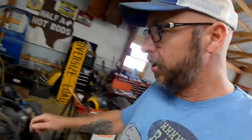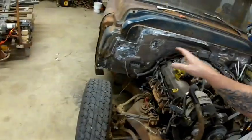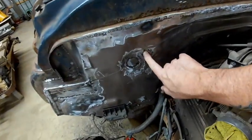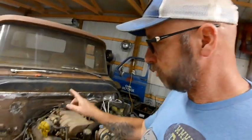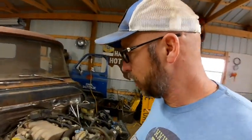So I think what we need to do is just scuff everything, scuff and clean, and then basically we'll paint prep everything here. I really need to address that. I'm going to try and unmess this up. I'll fix it. Yeah, and then we'll do scuff, clean, and then we'll do seam seal and paint, because once the cleaning is done, then we should be ready for seam seal.